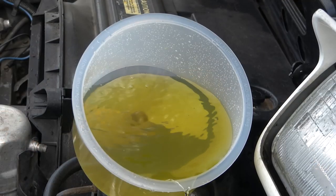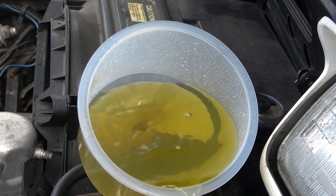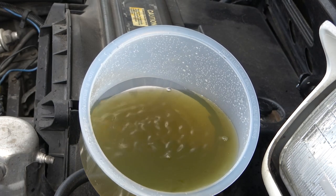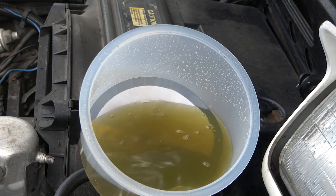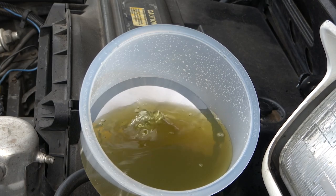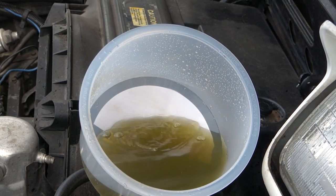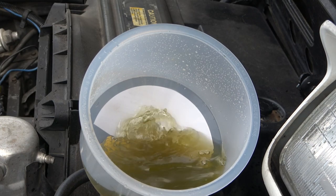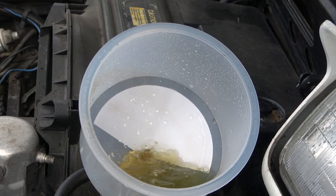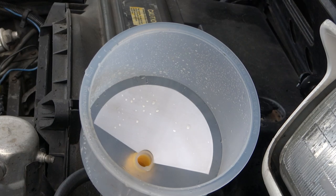Let's go outside and take a look at what's going on. We're starting to get a little coolant bubble, and you can see we're still getting air bubbles out of here. We're going to give the engine a little bit of a rev to get all those bubbles out. There it goes — thermostat opened up. Now we're burping all the air out of the engine. When that thermostat opened up, our coolant fan came on and our temperature is starting to drop. See how much coolant it took? Pour the last little bit and get our other gallon — totally starving for coolant. That's why this car was overheating.